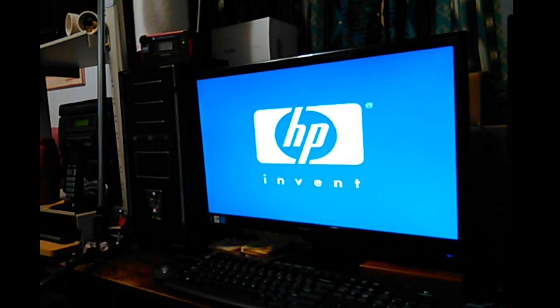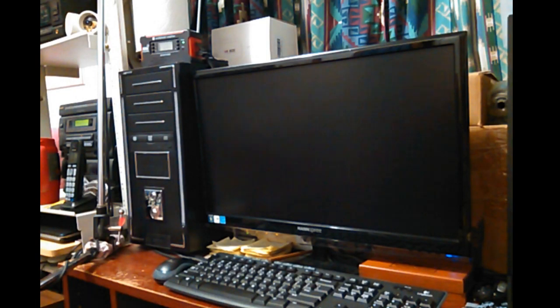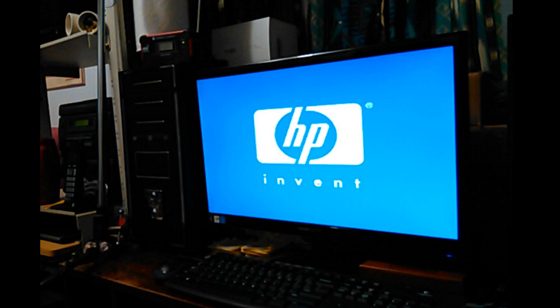Fedora, you can't. Well, you could do it, I'm sure, if you knew how. But from stock, the CD doesn't allow you to; it's going to look for the hard drives. I mean, there might be some switches. If you did some custom boot options, you could probably do that. I've never got into trying to. I can't remember all those command line options and commands very well, just a few basic ones. You could go into a custom boot mode and write in some switches and tell it not to mount any drives. And then it'd be a temporary change, not a permanent one. I think it rebooted.